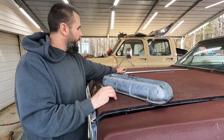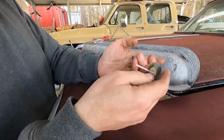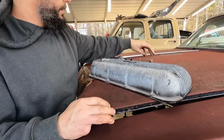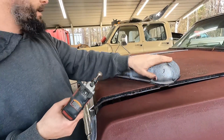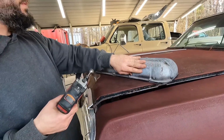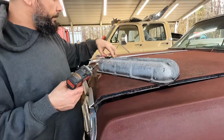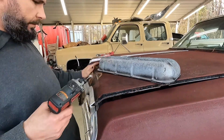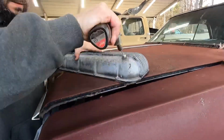All right, these are a couple of those really super fine stainless brushes from Harbor Freight. They're great with aluminum. I've done all kinds of stuff with it, but I'll just do a little bit of it. And then, actually what I do is after I get all the oxidation off, I go back with real fresh red Scotch-Brite and then just kind of dull it back up. But try not to scratch the finish on the Impala. I hate to decrease the Barrett-Jackson value on this thing. I'll show you what this does.